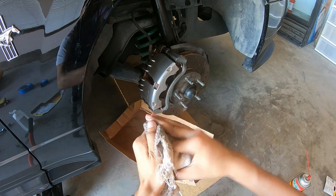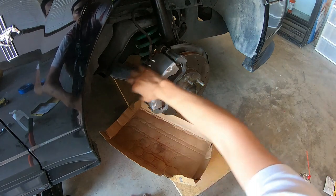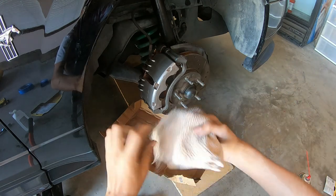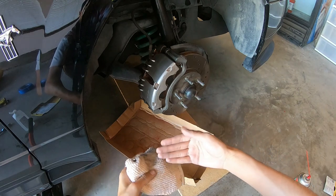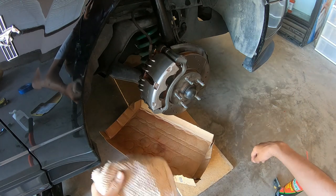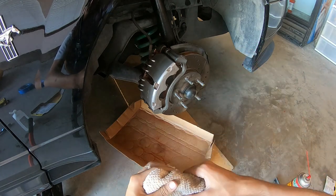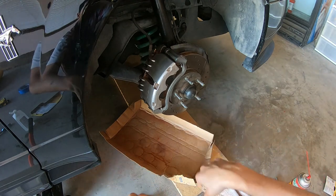A test I like doing is cleaning my hands and checking that my fingertips are back to original skin tone. Get the rag with alcohol and clean them off. I like getting my bare hand and touching all around the caliper. If my fingertips are dirty, get some alcohol with the rag and start wiping it down - keep doing it until my fingertips are clean and it looks like I didn't even touch it. At this point, whether you had painted or unpainted calipers, you're both at the same process - making sure it's clean and prepared for paint.